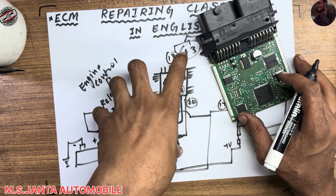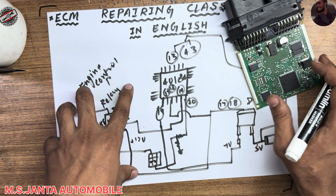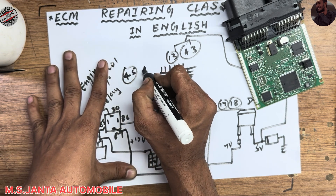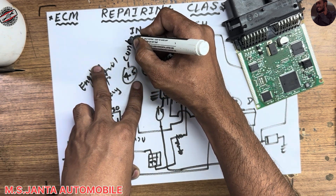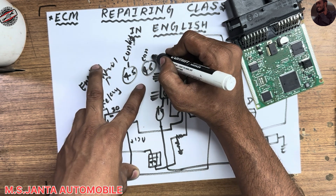Once the full board is on, all the ICs receive their enable signals, and CAN communication is established. IC pin number 45 is CAN High and IC pin number 46 is CAN Low.